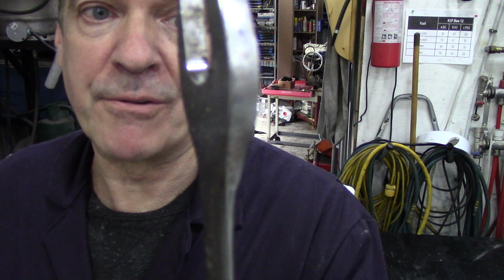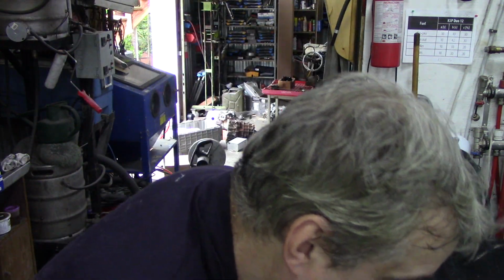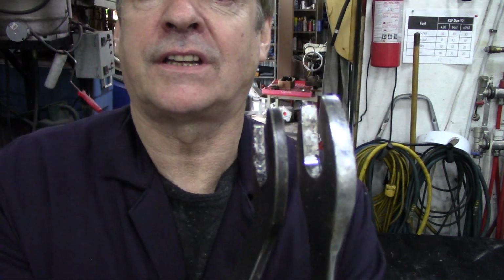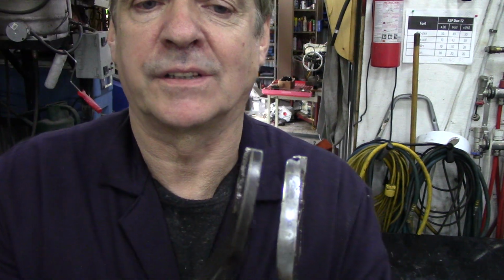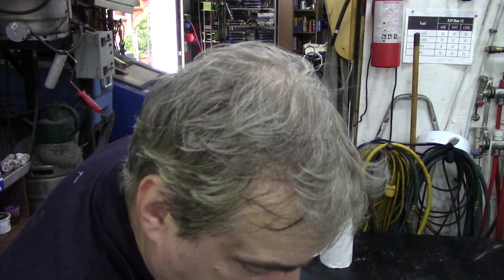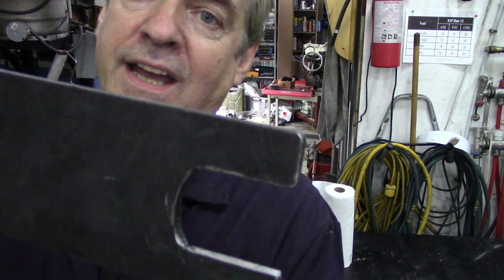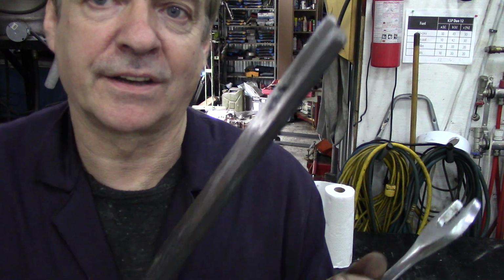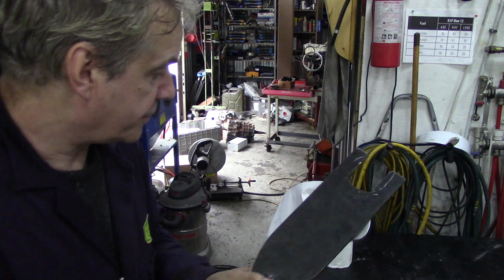And this is ground down from being really, really thick to something that's, well, you can see the difference in thickness, look. These spin round, these bloody rubbish things, but like I say, these are a bit better metal, even from China. But in conjunction with this paddly type tool to lock the pulley whilst you get your bolt out, it is brilliant. You can crack them off in next to no time. There's no need for heat or WD-40 or anything like that. They'll just spin right off, so that's good.